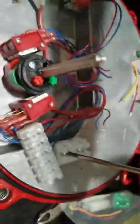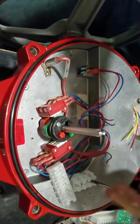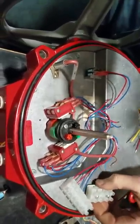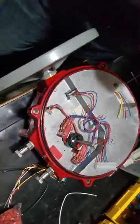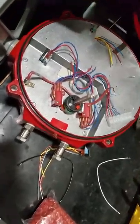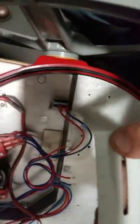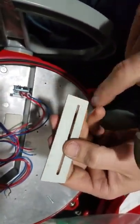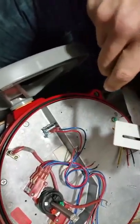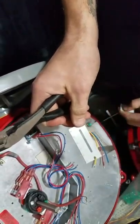Next, we can pull this strip out, put it in with the other pieces, and replace it with what we just wired up. Also, we have a new label for it. I'm going to use the lettered side. Goes A through I. We're actually going to cut it off after F. And that's going to match up with the amount of ports on here.